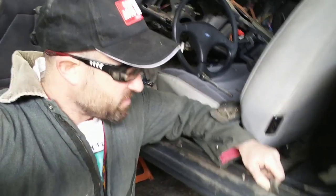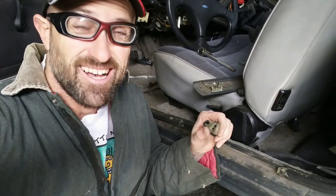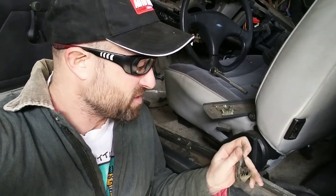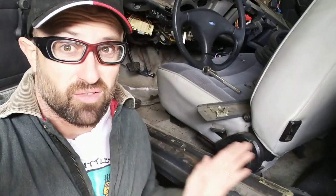Next step is to get rid of the seal itself. Once you want to get rid of the seal, you can basically pop it up — it should be two halves. So you can just take it and kind of pull it, take it all the way off. As you can see, this one has a ton of silicone on it. Apparently the previous owner thought they would just get by with a big mess of silicone. Now the placement of this joint here — you can see it's right by the seat — it's really going to be kind of up to you where you want to put that. You can put it back in the same exact spot. On the 80 wide body, it was towards the front of the door.